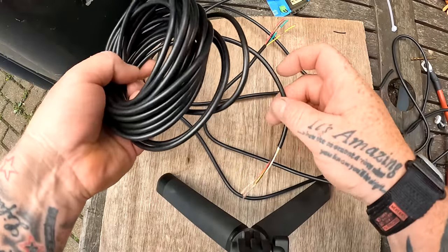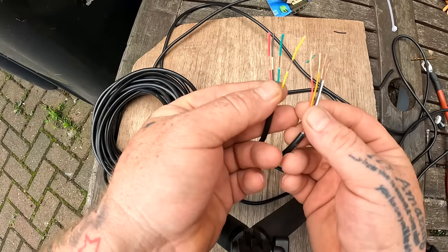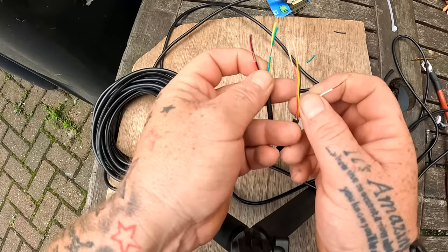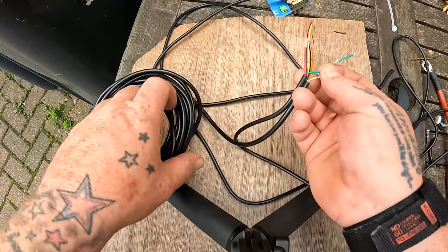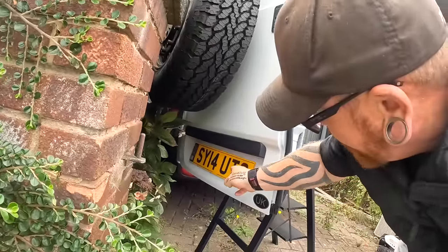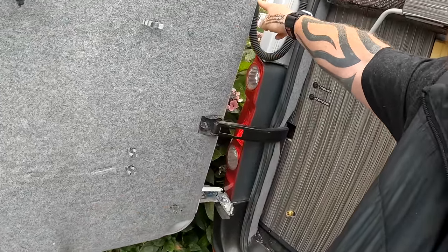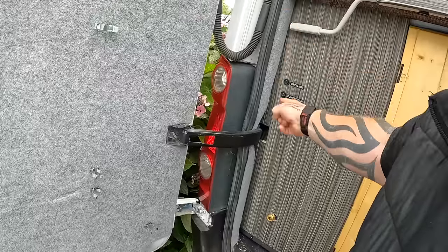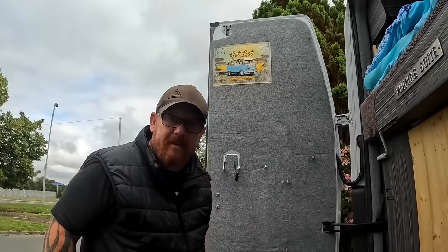I've got a big reel of four-core cable in there. It's not the same colours - we've got red, black, and yellow on the existing one, and red, black, yellow, and green on the other. We'll just use white for the green, and all the other colours are exactly the same. Let's get these soldered up and get the cable extended. The number plate is down there - we've got to bring a cable in through here, go up through this gland, come down and go right under the van to the very front. But we need to get the door panel off first so we can screw it on, so let's get that off.